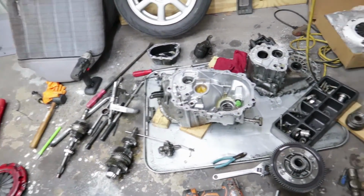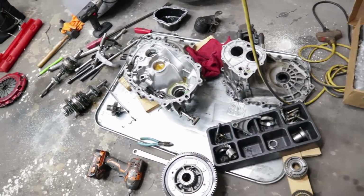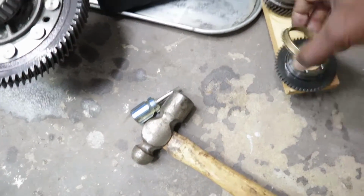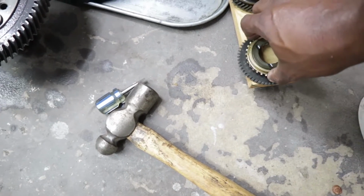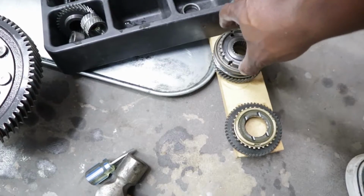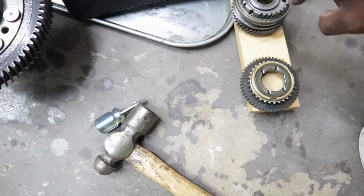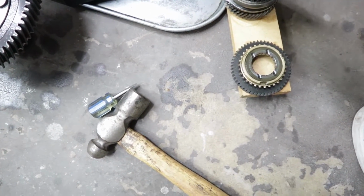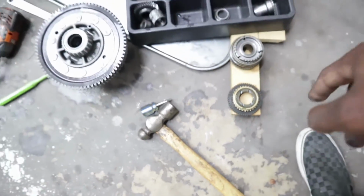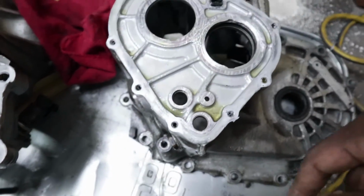Turns out what happened when me and Greg put the transmission back together, we forgot the fifth gear upper synchro. We just completely left this guy out entirely, and so that allowed this collar to move up and push the little ring that holds a couple of clips in place here. That ring, that retaining clip popped out, and so did the one on the bottom of this hub, and it got ground up inside the fifth gear housing on the transmission.